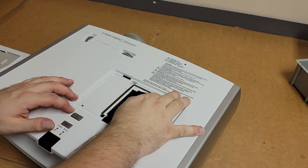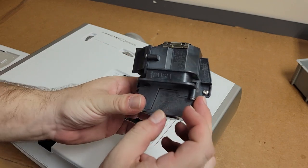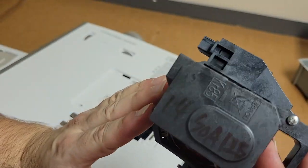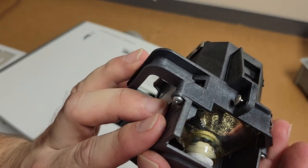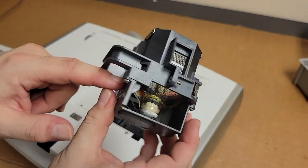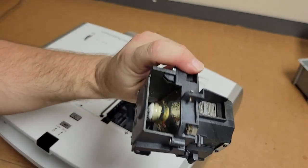I don't do a lot of Epsons on my channel because service info is very hard to come by, and Epson does not sell parts, at least not to me. This looks to be an original. It has the markings here that make me think it's an original, but it has this kind of, I don't know what that's about on the back. They do have the KR85 marking, and the bare lamp here says it's a UHE 200E, 200 watt 80 volt, made in China, which is what they should say. So this might be an OEM. We'll pretend it is for now, but usually I expect to see that little Epson original sticker. So this might be a high copy, but we're going to pretend it's real for now.